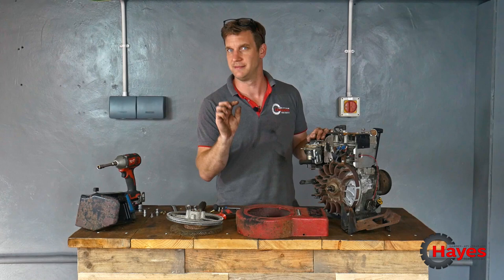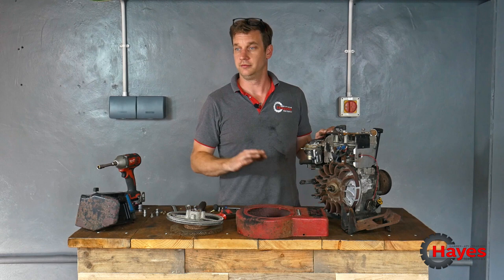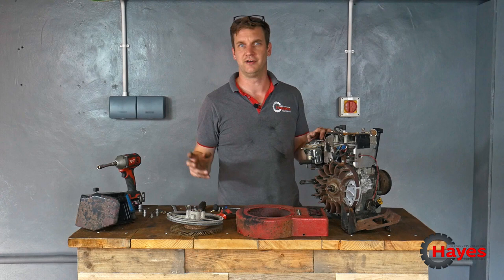One thing we're not going to powder coat yet is the bonnet. We're going to bring the bonnet back all shot blasted, fit it on, make sure it's right, weld it up, make sure it all fits, and then take it back to get powder coated then — in the beautiful gold that we keep mentioning. I don't want to get it all powder coated and then find out I've got to cut or weld a bit for it to fit properly. It's best to do it that way around, although it's a little more travelling.